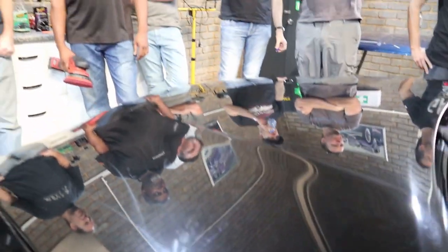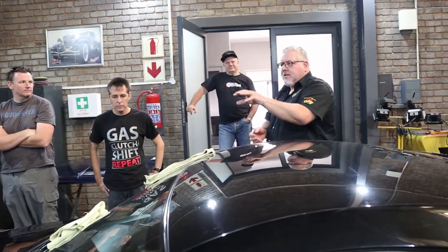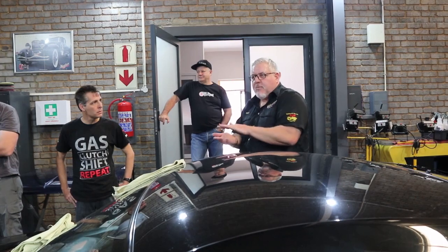Yes, but now the swirl marks are much more visible. Prominent is a good word. That's the difficult part when you start working on a car and doing these processes: everything gets more and more prominent. So each step, if you don't do it properly, looks worse and worse the further you get. So it's very important in that starting process of doing the decontamination, getting to the compound and getting to polishing that each step is done properly.